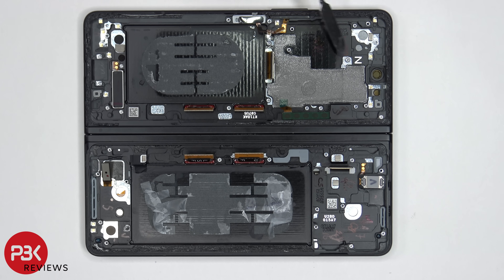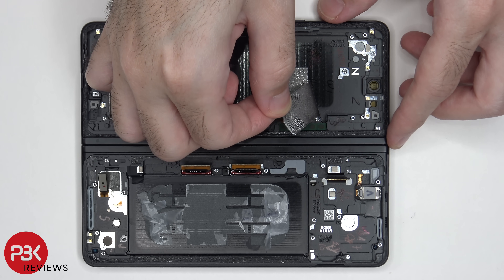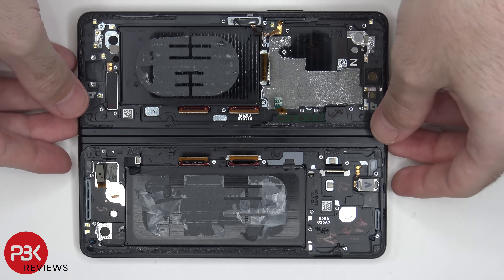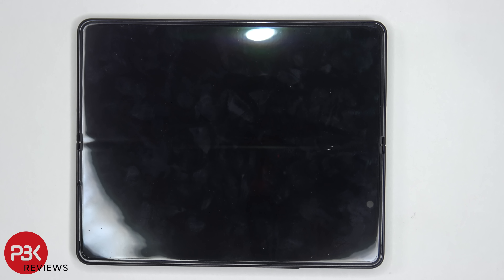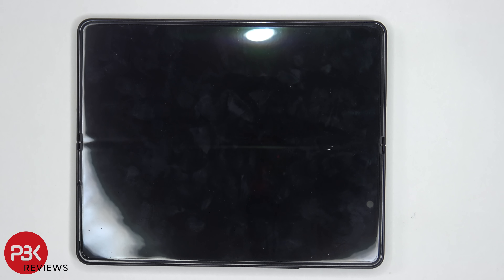Here's the 3D layer of graphite underneath the main board, which basically helps transfer heat. If you needed to replace the foldable screen on the other side, you need to gently apply some heat around the border of the phone, then pry off the plastic borders, and once those borders are off, you'd have to gently pry the screen portion off from the mid-frame.